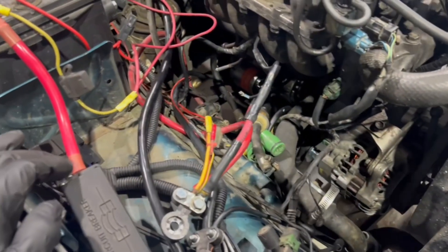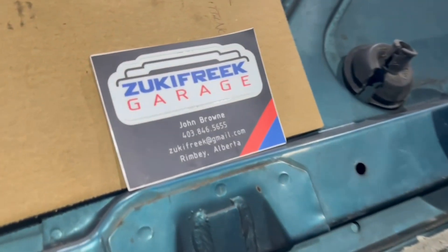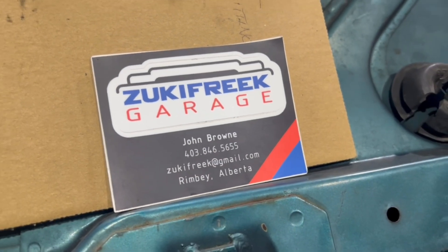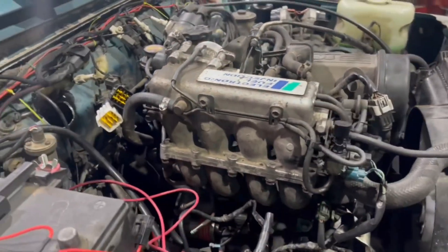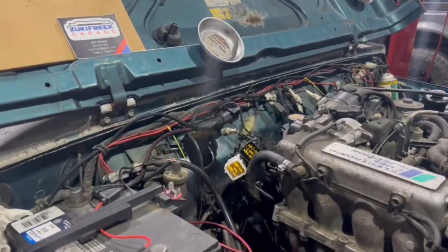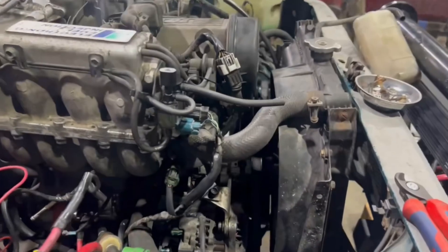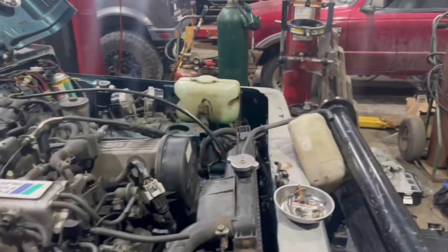I obviously have a lot of cleanup to do under this hood — lots of wires from the old wiring harness that need to go. I knocked a hole in the firewall with a two-inch hole saw and got a grommet from the donor vehicle. Shout out to John Brown of Zuki Freak Garage for building the wiring harness — he's out of Rimby, Alberta. Pretty much plug and play. Got the harness and the ECU, that's about the last thing we've got to do besides the fuel system.